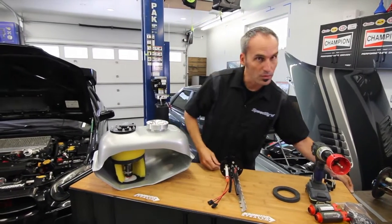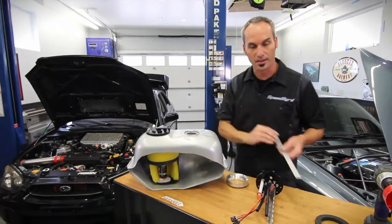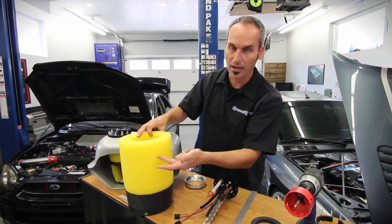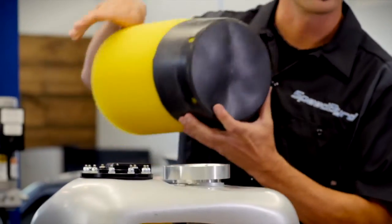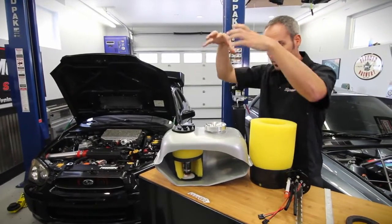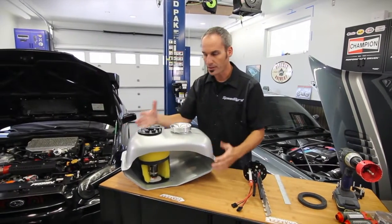You want to come by with a ruler and measure your depth — that's going to set not only your pump depth but your baffling system. Take that same measurement, cut off the top of the hanger, use the same tool to scrunch it down and feed it right through there. It's got a nice radius — let it pop back open, drop in your pump module, fold it down, and you're ready to go. Once this tank is out of the car sitting on a bench, you can get this done in about an hour, which is pretty amazing.